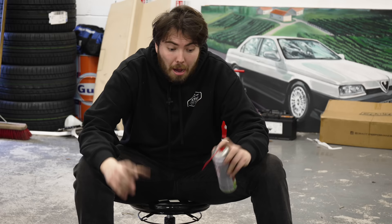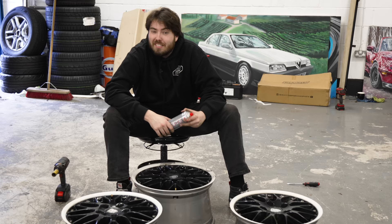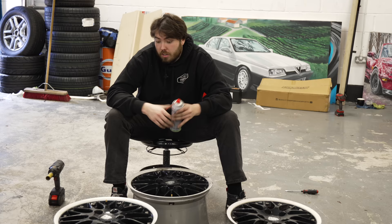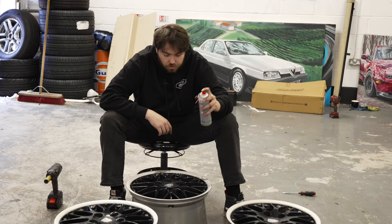Thank you to Tyre Streets UK for providing these epic tyres. So while Will is doing some of the other coilovers, I'm going to take these wheels apart to get refurbished. What I mean by taking them apart is that these faces come away from these barrels — it's an old motorsport thing. If you damage a barrel while racing, you don't need to replace the whole wheel. You can take the very valuable lightweight centres out, get a new barrel and go racing. So we need to undo every single one of these bolts.